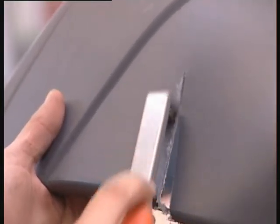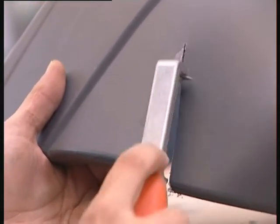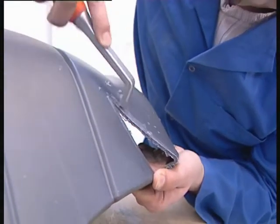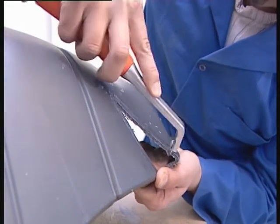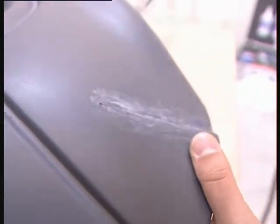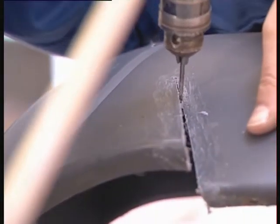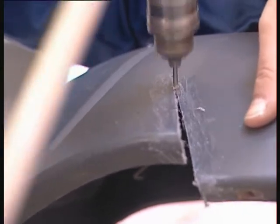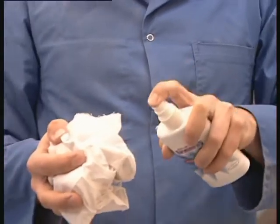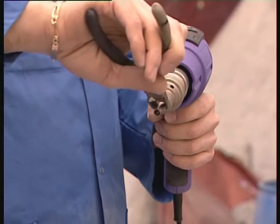The scraper allows you to scour the paint around the break to ensure proper adherence. Use the drill to make a hole at the end of the break. Use the countersink to clean the chippings and other residue from the break. Apply the Reparshok degreasing agent to a cloth and not directly on the plastic. The preparation of the substrate is now done.